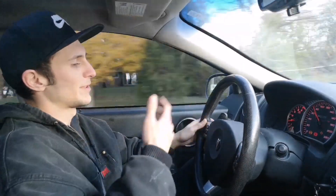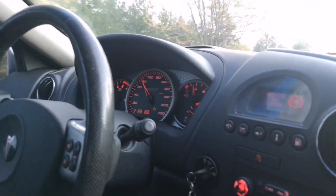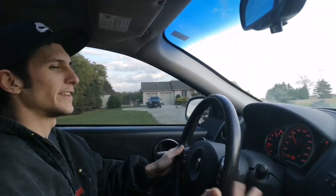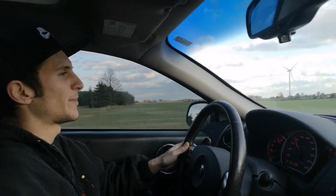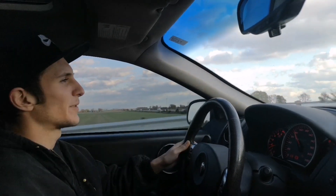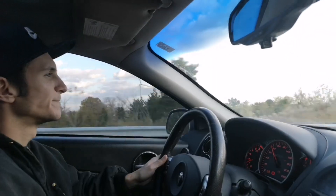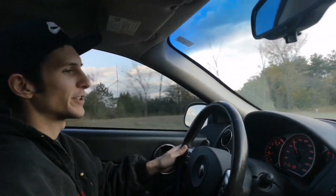Alright, finally got the alignment done - wheel's straight, got some new front struts on there as you guys just seen. She's riding pretty good. The only problem we're really left with on this car - it's got a bunch of lights on the dash. Other than that, it needs some new tires, and I don't know what's going on with the power steering. I guess it's got that adaptive steering and it says 'service it,' but the fluid's not low - it just seems like I have zero power steering. Comment below if you guys know anything about that.